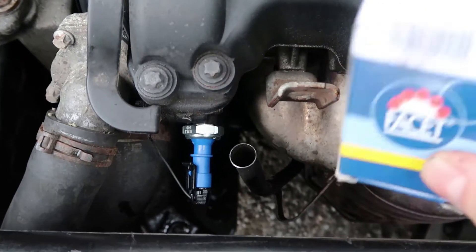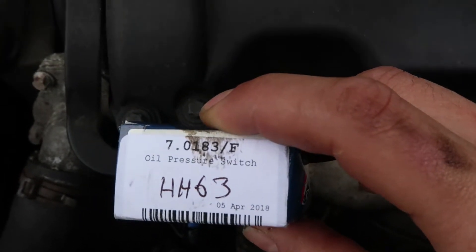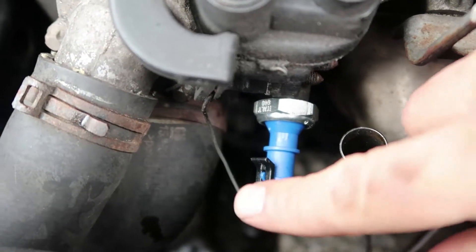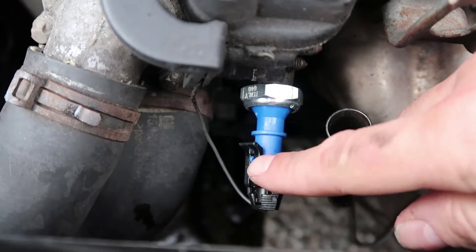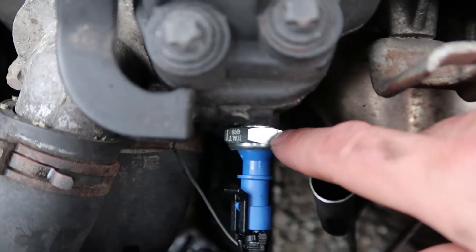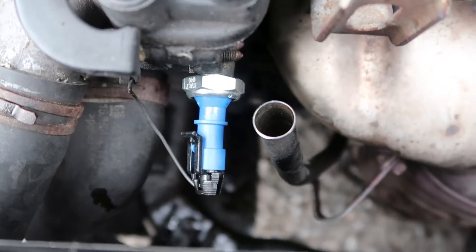There's no exaggeration, this took me roughly 10 minutes. There's the offending article — the oil pressure switch — and there it is, new one. All you have to do is unclip this little black bit off the top. There's a little tab on the new one and that clips back over. I literally just cleaned this up, screwed this on. I didn't do any torque — you just did it till it was tight enough. There's a little washer in there, keep that on, and just nip it up. That is it, done.